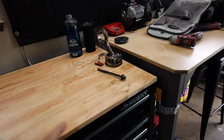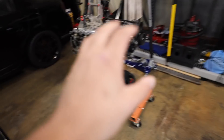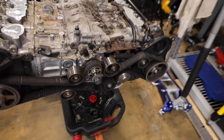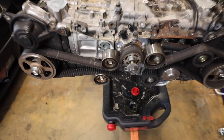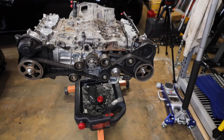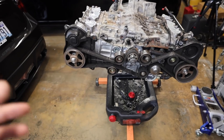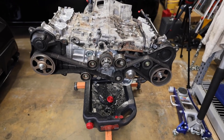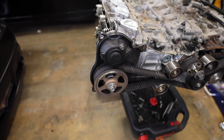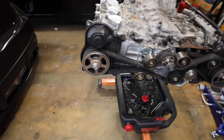Let me show you guys something real quick, and then we're going to get cracking into this EJ. Shout out to the mod garage for giving us these stock EJ internals — we have a piston, a rod, a head bolt, bearings, that kind of stuff, just to be able to compare against the EG. We did get the timing cover off and that pulley off — it took both Matt and I to be able to get this guy off. So now that we have the timing cover off, I'm going to get going on getting all these timing components off. The way I'm going to do this is take off the tensioner, get all the tension off the belt, get the belt off, and then just start pulling all of these pulleys off to give us access to get these heads off. I'm not quite sure about how I'm going to tackle these cams yet, but once I get one side figured out, I'll walk you guys through it.